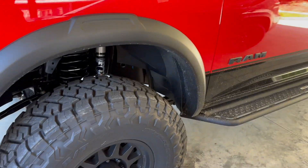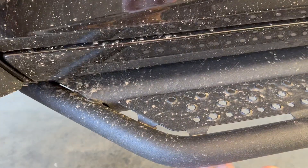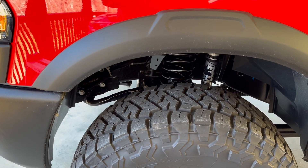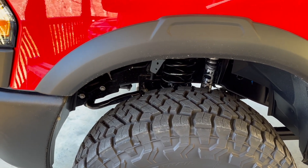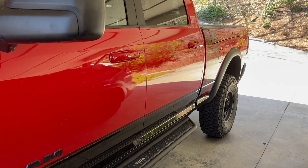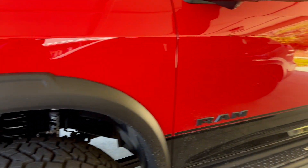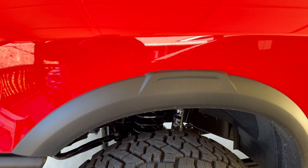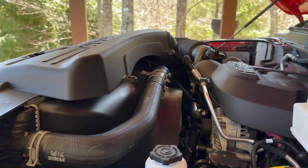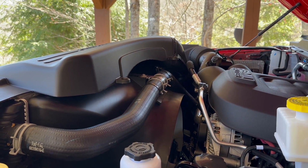I think 20 inches of water would be no problem with this truck — 20 inches would get you right underneath here. That would work for even the front vent tube, and hopefully that tube itself is made so you really can't get any water in there. Maybe at some point I'll extend that front tube up, but the other vents seem okay, the alternator seems okay, and the air box is pretty well protected up at the top. So I think I should be good for going through some water.